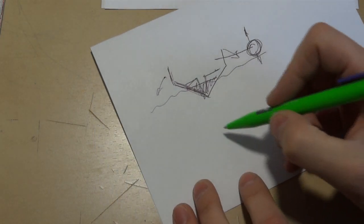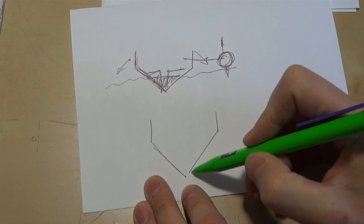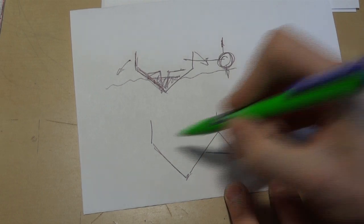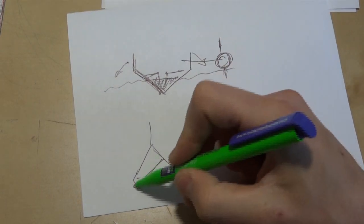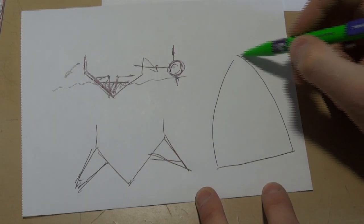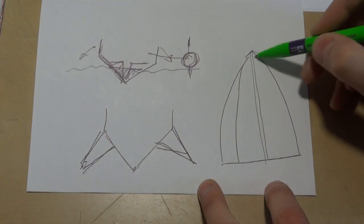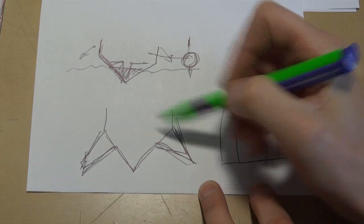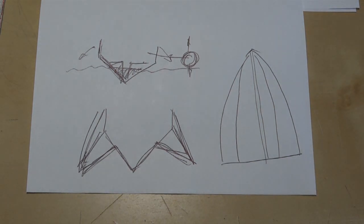What I think I'm going to do is make a modification to the hull design. So here's the exaggerated point of the hull again. What I'm going to do is add some bits onto the outside - stick expanded polystyrene down the hull lengthways, and then stick some extra pointy bits down each side and skin those over in fibreglass. So effectively we end up with a tri-hull, which should be much more stable and come a bit wider at the sides.